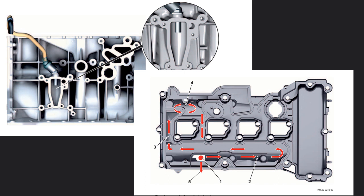The oil separator is in the form of a cyclone. Incoming air is made to spiral and the resulting centrifugal forces separate the oil, which flows back into the housing. The air cleaned in this way leaves the oil separator through a combination valve installed above the cyclone, which acts as a check valve in the event of overpressure in the charge-air distribution line and is an air shut-off valve to protect the catalytic converter. The full-load ventilation line runs from the oil separator into the charge-air line upstream of the turbocharger. The oil separators are integrated in the cylinder head cover. The full-load ventilation gases emerge on the exhaust side. A parallel double cyclone oil separator provides highly efficient and precise oil separation.